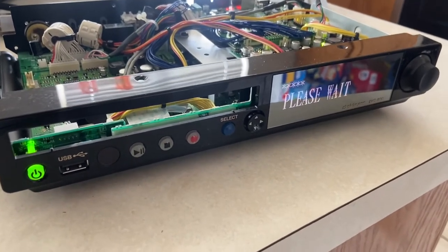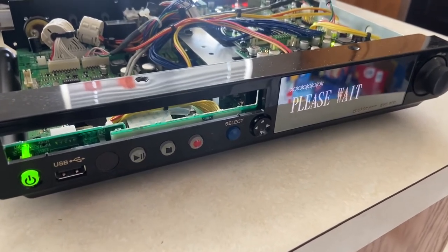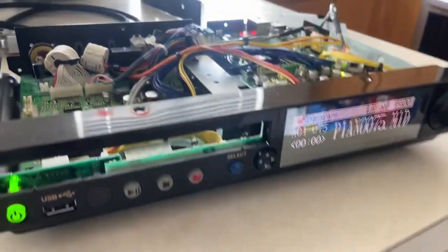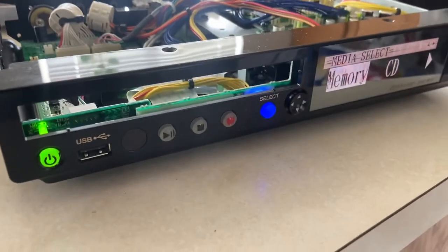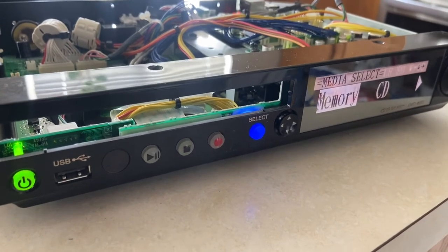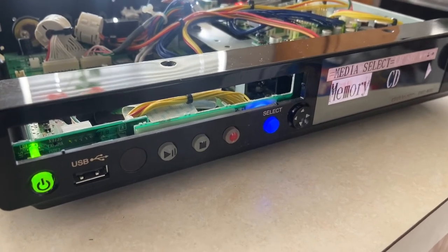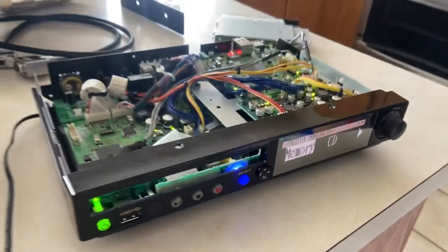But that doesn't mean this system isn't wonderful, because it is. All you have to do is flip switch number one to the on position and the E3 turns into a DKC 850. What's nice about this is you can use this on any Disklavier except for the Wagon Grand — with the Wagon Grand you can, but you have to use MIDI cables. This DKC 850, along with that little DKC converter board that I made, will allow it to work on the Mark II pianos. Great news — I just wanted to share this with everybody. We'll talk to you later, thanks.